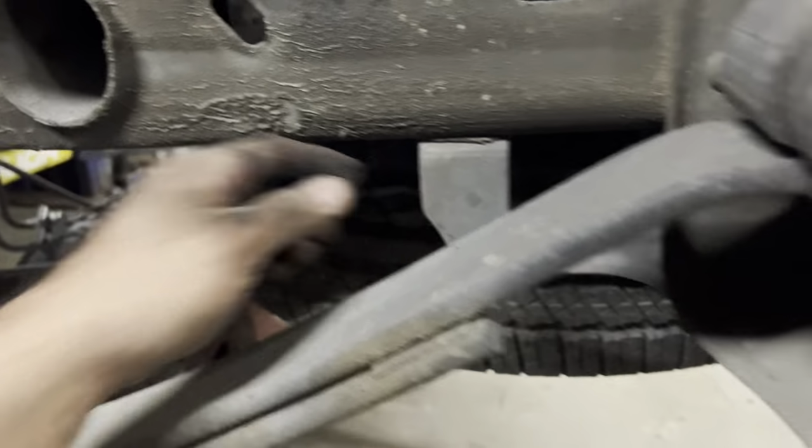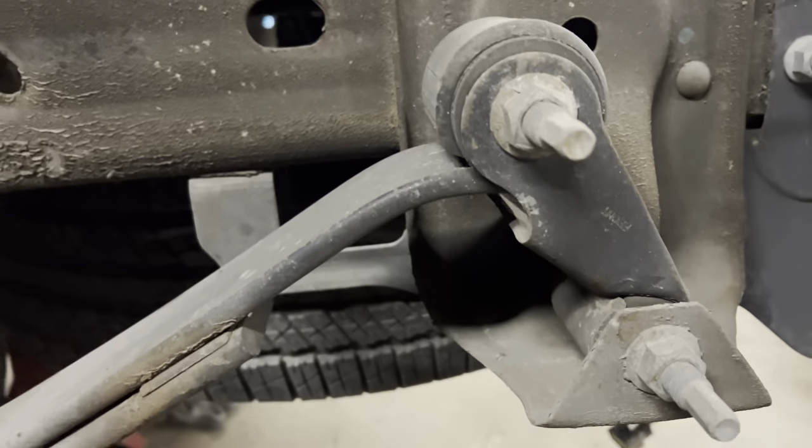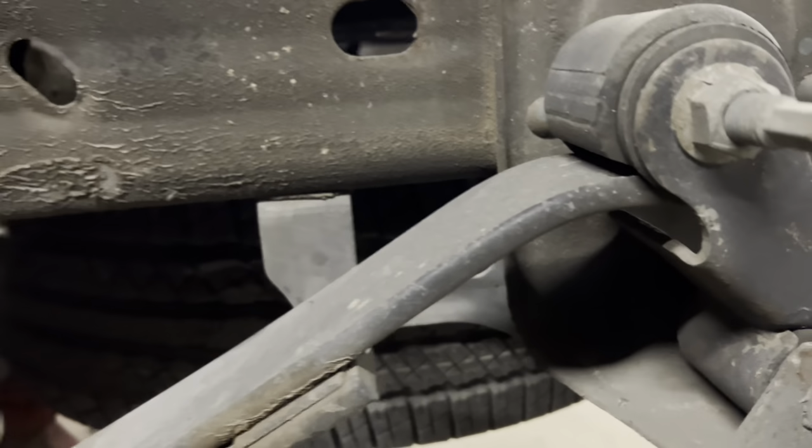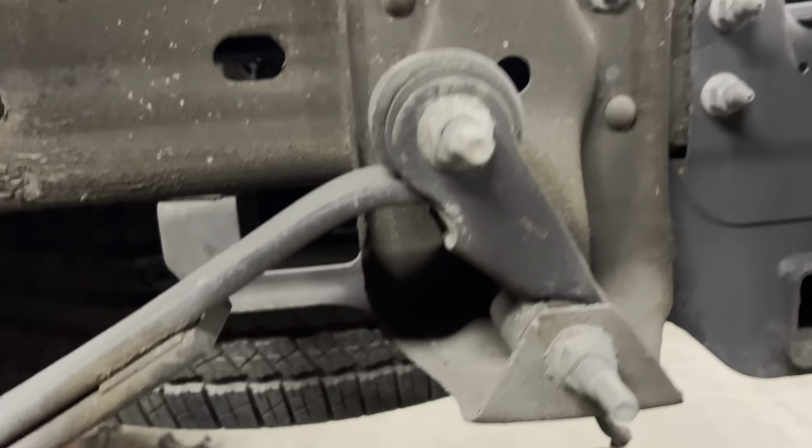There's three bolts on each side. These two are actually a bolt. The third one is a bolt going up into the frame of the welded nuts. You have to hold the top and hit the bottom of this. You got to get the hitch loose because you can't get this bolt out. It hits the hitch behind there.